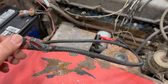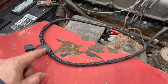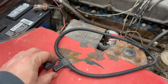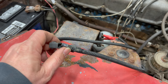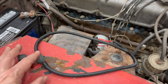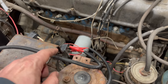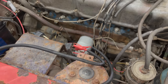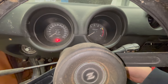This is a handy tool I built a long time ago — basically it's a standard alligator clip set with a connector for a fuse. You can buy these circuit breakers at an auto parts store and they fit into a standard spade fuse box. This one has a 25 amp circuit capability, so if I connect it to something that draws more than 25 amps, it'll trip the circuit breaker and cut the power. I have the alligator clips hooked up where the fusible link would go. I'll hop back in the car. Turn the key — hey, there we go! Now I've got power.